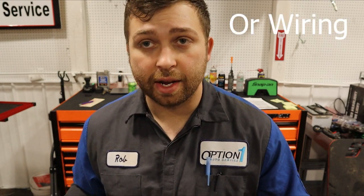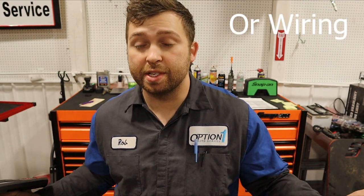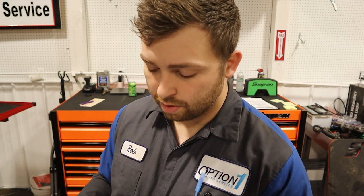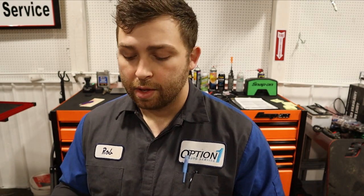And one of the very good things is on the charging system, some of these newer cars have alternators that are commanded on by the PCM, and when it's not charging anymore, it sometimes isn't just the alternator, it's actually the ECM. The ECM's bad. So this will give you a pinout and a known good reading, so you can do your lab scope. And if your reading is not matching your known good reading and you're doing it right, then depending on the procedure, it'll lead to showing your bad alternator or your bad PCM. So that's pretty cool with this thing.